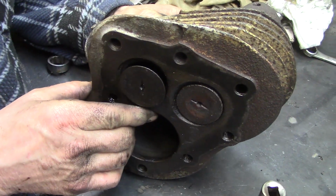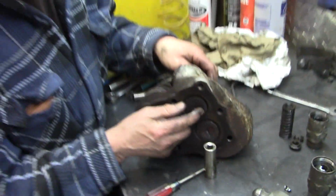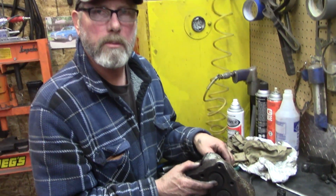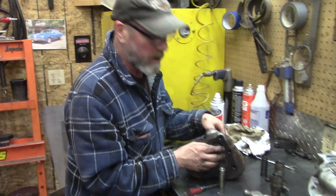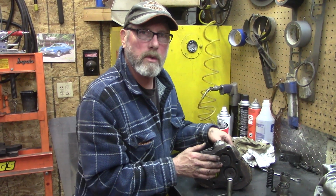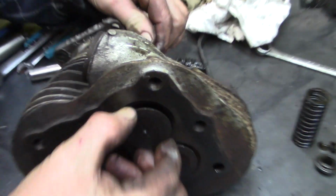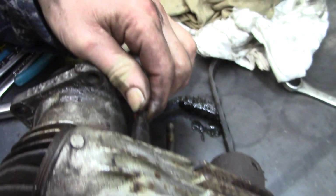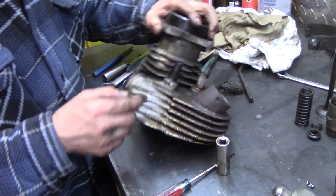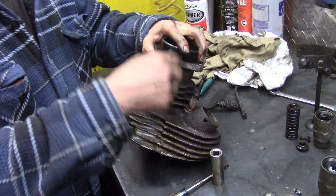Now there's no way a valve can seal if it's dancing around, if you got an oblong hole, touching on one side, touching on the other, touching over there. So that's why you got to keep your valve in the center of the guide, and they give it 1.5 thousandths usually. I don't know what it is for an air-cooled engine. It's been a while, but this one, I'm grabbing it like here and here, and I'm wiggling it, and you'd have to mic it up. They heat this up, knock it through, I think that way, because this has got a shoulder, and just press in new ones.